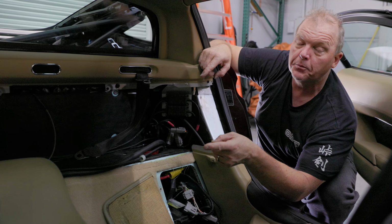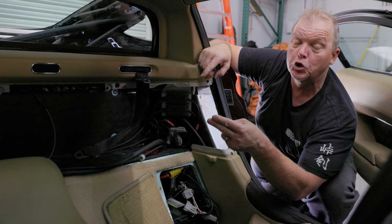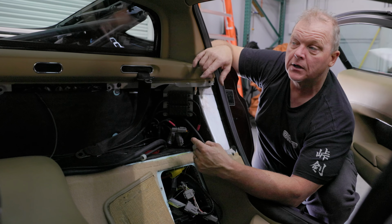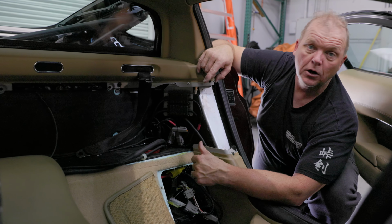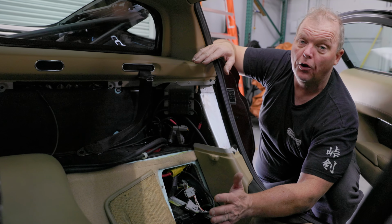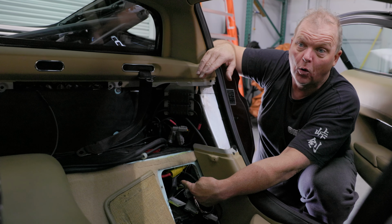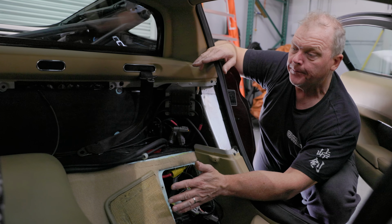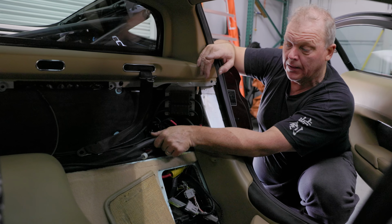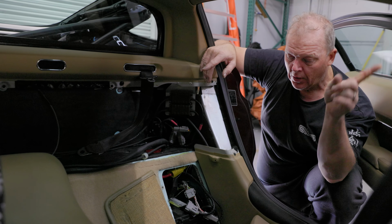And at this point, there's three separate plugs on that harness that were too large to go through the hole that direction. And obviously with the flange on it, it wasn't going through the hole this direction. The only way to take the original harness out was to completely de-pin it up inside this hole. Once that was done, I basically just took the measurement and I was able to make this cable that you see here completely in my office on the bench.